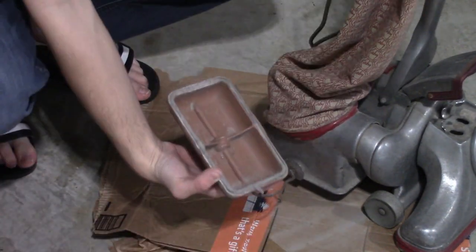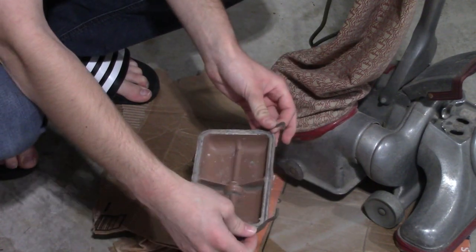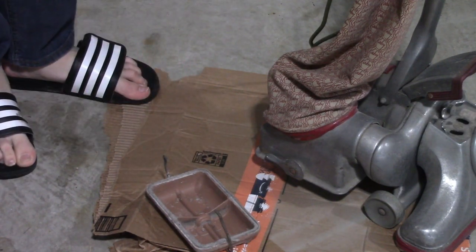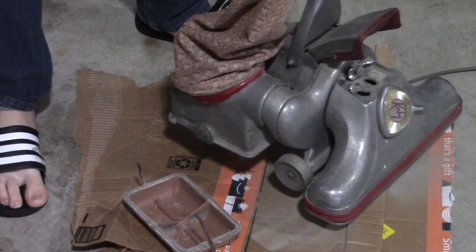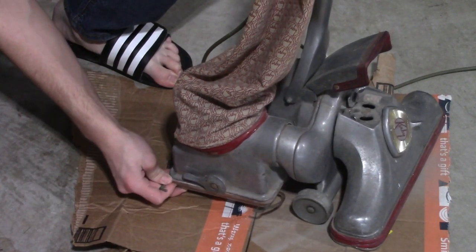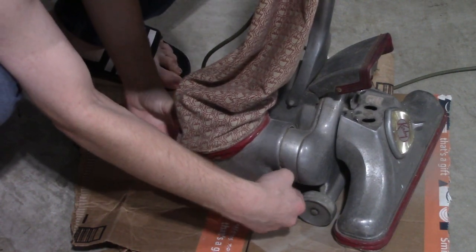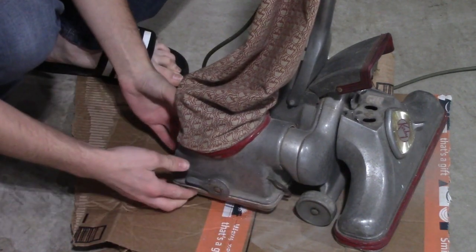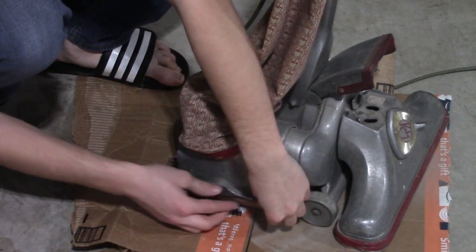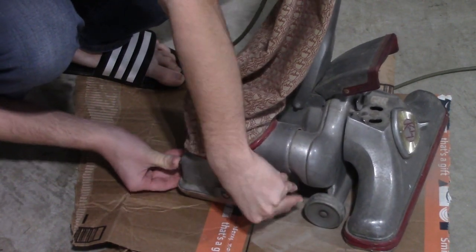Take this to the garbage. It is now empty. Now we're going to put it back on. You'll notice the tray is not that big, so you really want to be proactive about emptying this — when I bought this vacuum it was so full it almost made an explosion when I took it out. Putting it back on can be a little more difficult. Line it up underneath here like this; these metal brackets hold it in place. You'll see the two tabs on the side — put one hole back in, find the other one. Snug it up real tight and push those prongs well in there. If it's still loose, keep pushing the prongs and then push it in place. This thing will not come off unless the prongs are held in.